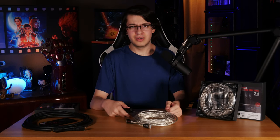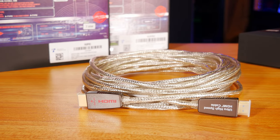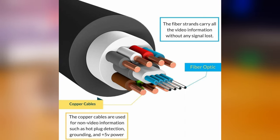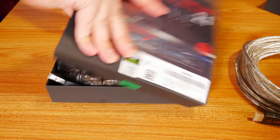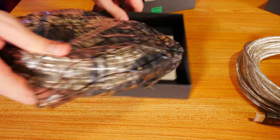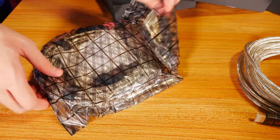But with so many of these HDMI cables just flat-out dying, we wanted to look for a better solution. And this led us to fiber-optic cables, which, unlike standard copper cables, actually use really compact fiber-optic transmitters and receivers at each end of the cable to move a signal. Both options ultimately do the same thing, but fiber-optic cables introduce a few key benefits. One of the more important of those is signal integrity — since the video signal is converted into light and sent down the fiber-optic strands, it can actually travel much greater distances than a copper cable without signal loss.